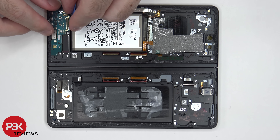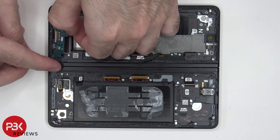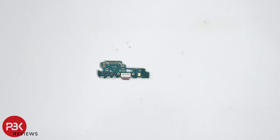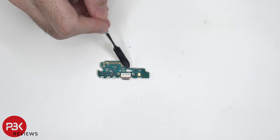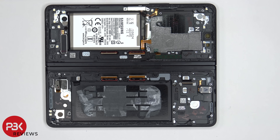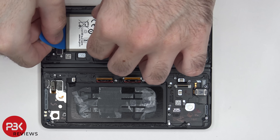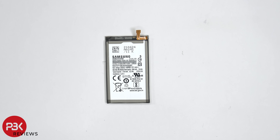The subboard can now be lifted up and removed. The charger port is located right here and there's a red rubber gasket around it. The primary microphone is located right here, and there's a liquid damage indicator — this white sticker here. When it comes to replacing or removing this battery, this one also does not have any pull tabs, so we need to use some isopropyl alcohol around the sides of the battery and let it sit for about a minute. This battery is a 2,120 mAh battery.